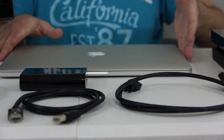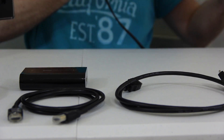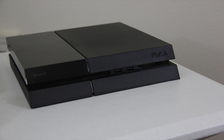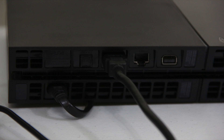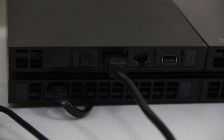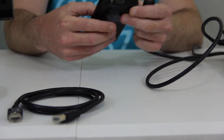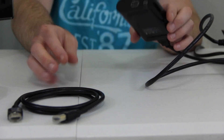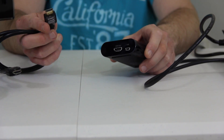We've got the PS4 over here and the MacBook here. I'm going to turn around the PS4 so you can see the back connections. Take the HDMI cable and plug it into the HDMI out on your PS4 — that's all you really need from the PS4 side. From HDMI out on your PS4, you're going to come into the HDMI in on your Elgato. Then take that other supplied HDMI cable and plug it into the HDMI out from your Elgato.